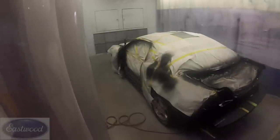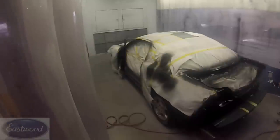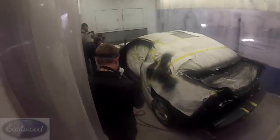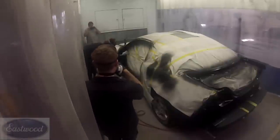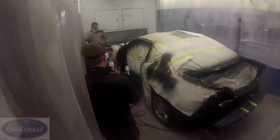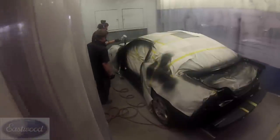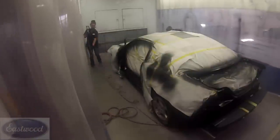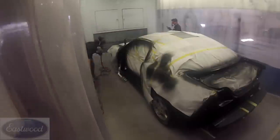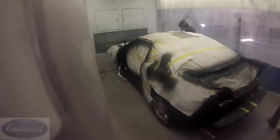Again, like I just mentioned, they're small areas, but a lot of angles. And you got to make sure that your gun has the right angle on it, that you're holding it right to get all these different angles. Getting up in the front of the hood, where the hood goes, getting those jams, the door jams, and the deck lid jams. And again, I said we'll have to paint the doors and hoods inside of all those at a later time.